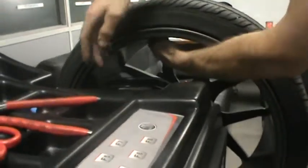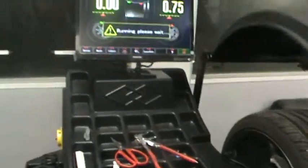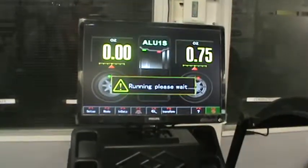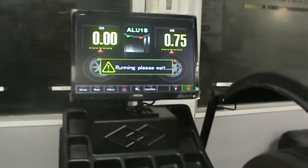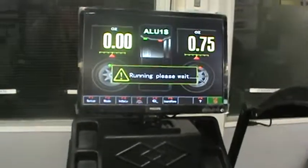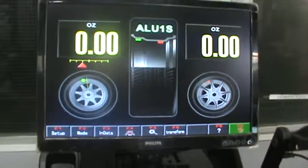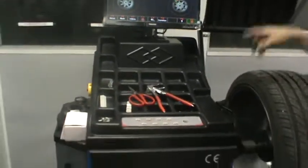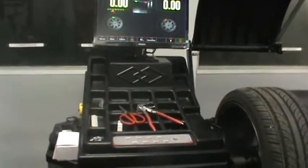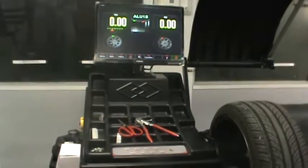You might notice it's going slightly ahead of 12 o'clock, not at 12 o'clock in this mode. Because this mode uses four measurements instead of the standard three, it's very accurate — one-cycle balance. Sometimes you'll get a quarter ounce, but it's almost always perfect zeros.